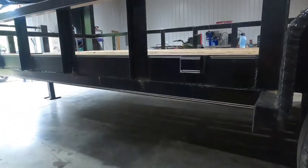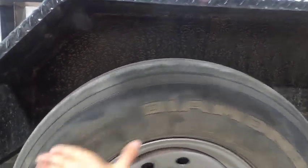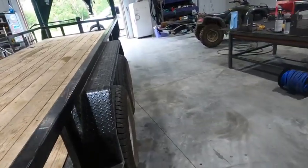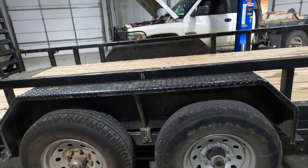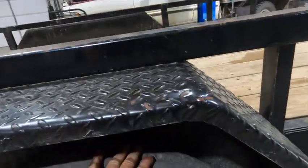I've got it all jacked up in the shop with two jacks in from the back, all four wheels up. He's already had the back two tires replaced, but I spun the front axle and this is what I found - it's moving up and down. So I'm guessing one of the cables or belts is broke. It does the same thing on this side, I think this one was worse. They're just 10-ply tires, and for a heavy duty trailer they just don't put heavy enough tires on them. That's probably what happened - old tires just gave way.